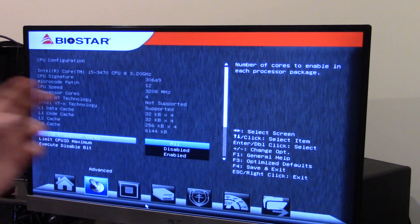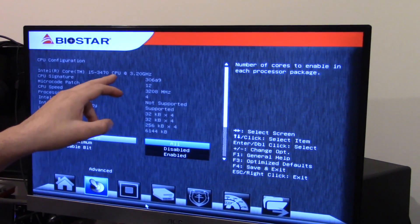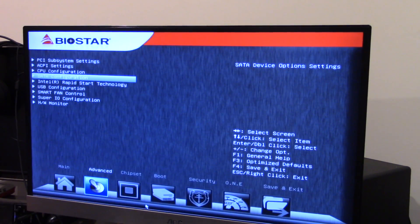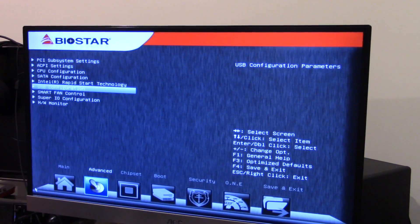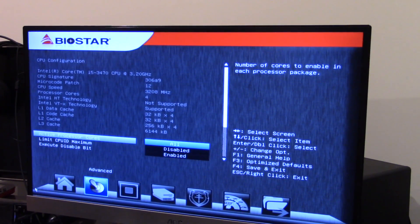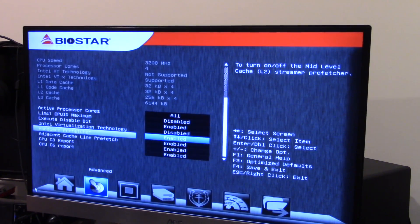As is the case with this processor — this is a Core i5-3470, it's a non-overclockable SKU — it runs at 3.2 gigahertz and it boosts to 3.4 gigahertz. So what we are going to do is go ahead and overclock and see what we can do with it. This only works if you have a motherboard that is capable of overclocking a processor, period. There are motherboards out there such as OEM HP and Dells that do nothing.